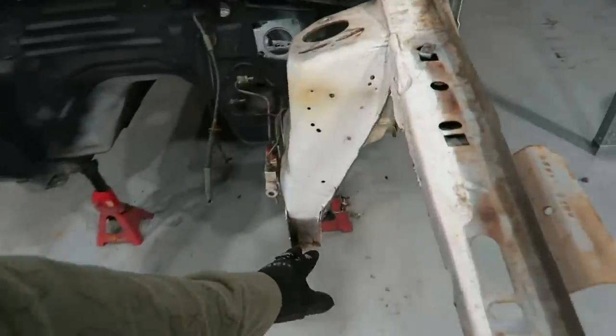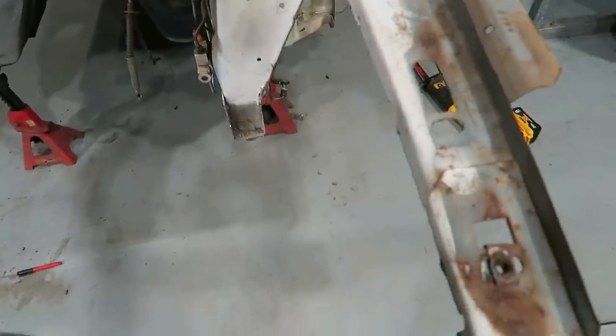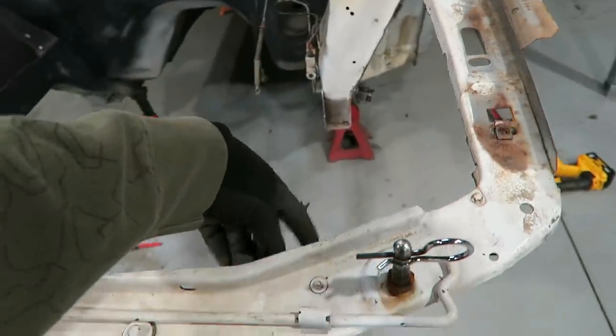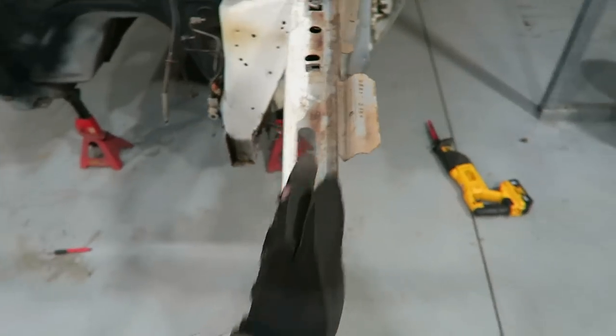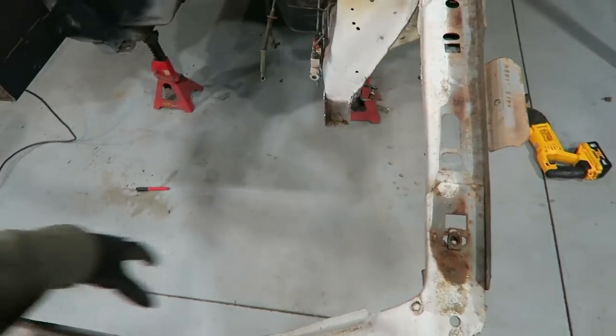I'm going to have mine kind of come out, bend around the tire, and then up. Most likely it'll kind of line up under this piece here, so it'll give me tons of room under here to work with. I may end up trimming some of this away — it's a little more flimsy than I thought, but I can tie it in. I did want to leave all the factory mounting places for the fenders, mainly because I'm getting ready to stick it back on so I can make sure the tubes line up where I want them.